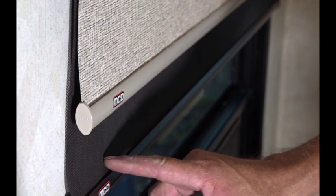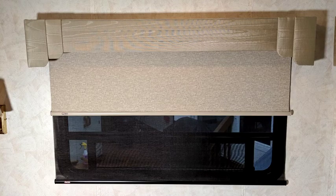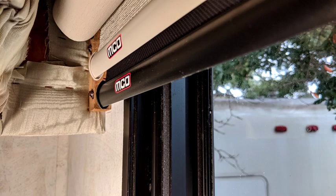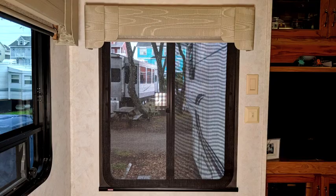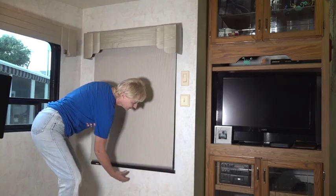In most American Duo installations, the Clearview Solar Screen should be located closest to the glass, and the night material should be closest to the inside of the coach. For proper operation, the shade must be level — solid spacers of appropriate thickness placed under the mounting clips may be necessary. The shade may not bind to anything throughout its entire range of travel, and proper operation requires clearance around all sides of the shade in the upper position. The shade assembly should be evenly spaced left to right and mounted to cover as much of the glass as possible when lowered. Repeat the same process on the remaining windows. The MCD American Duo Roller Shades were the perfect addition to our RV interior upgrade — now heat and UV rays from the sun are reduced, and we have daytime and nighttime privacy while still being able to see out. For more information, visit MCDinnovations.com.